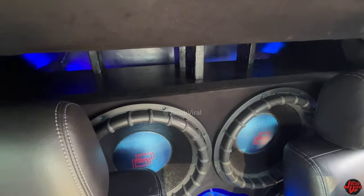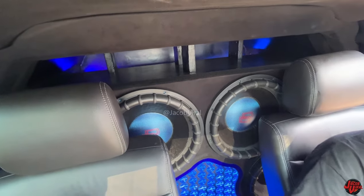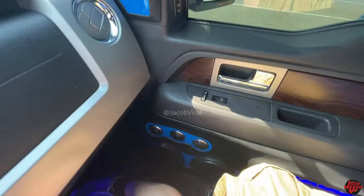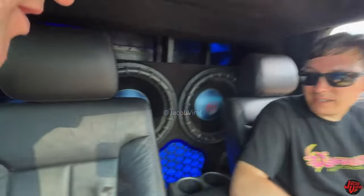What's in here, man? All right, so my name is Johnathon Earl. This is a 2012 Ford F-150, built by James Halter and Chris Reed at Stereo Video Center. Four DD-99-18s on two Crossfire 16Ks at half ohm each. Four Limitless Cyber 12Ks, a Mechman 370. That's my biggest issue, the voltage right now. Dropping low 12s, high 11s.